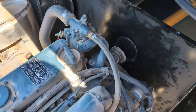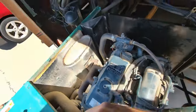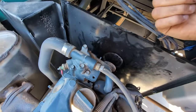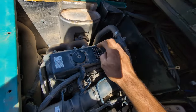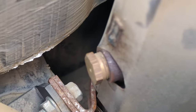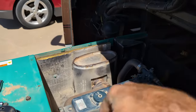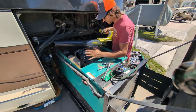With the engine apart, you can get a half inch extension in the back of the engine through the fan port to rotate the engine over. Another thing we have to do with the engine cold is the valve lash — we're going to open up this valve cover and adjust the valve lash, and we're going to have to turn the engine over in the direction of rotation. Also with the engine cold: this little button down there is the spark arrester and that needs to come out — the engine needs to run hard to blow out its soot. We can also replace the air filter and the fuel filter. First, I'm going to blow out a lot of the dust in here before I crack the engine open — we want to keep this as clean as possible.